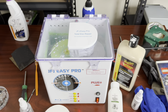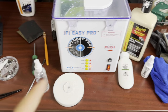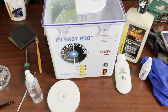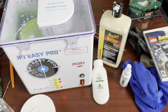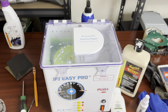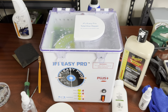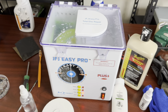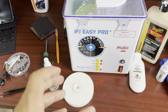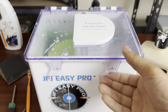The instructions are pretty bad — they have you do a buffing phase for about two minutes and then a polishing stage for one minute, but they don't say anything about spraying water on the pad. What happens is a lot of times these pads are pretty dry, especially the first few times you use the machine before the compound seeps in and softens them. The pad can get really hot on that disc and will warp it so the disc won't play — it might come out looking good but still won't read because the heat destroyed it. That's why I spray water: it accelerates the softening of the pad and helps the compound really absorb and seep in.